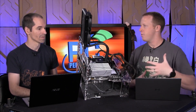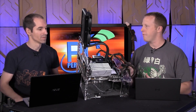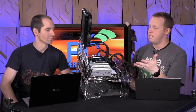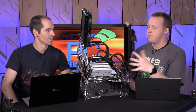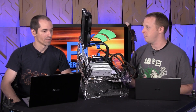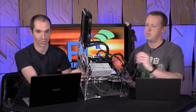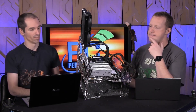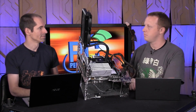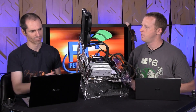This is an x4 PCIe 3.0 SSD, so in theory you'd only need 20 lanes plus whatever you want for the graphics card. But because this motherboard is designed for GPUs, not SSDs, it has plenty of PCI Express, but divided up to give you at least 16 or maybe eight lanes per slot. The four bottom slots end up being x8 on each one.